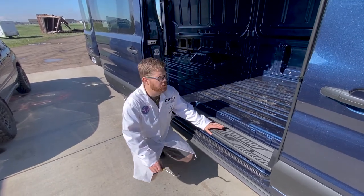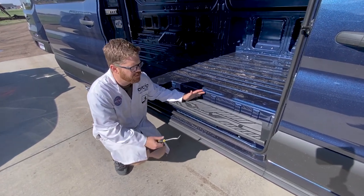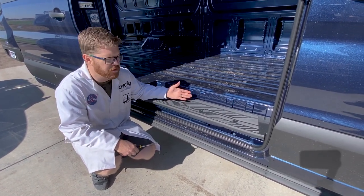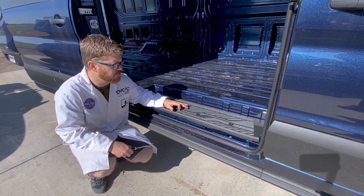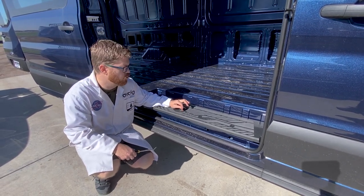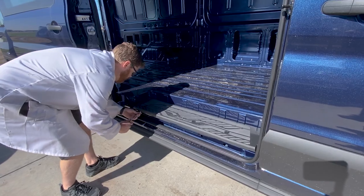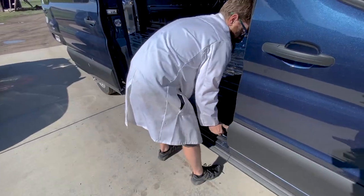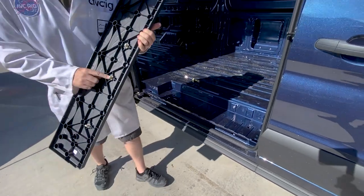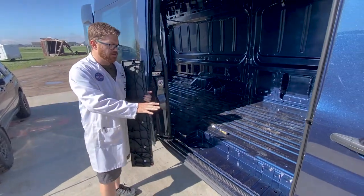If you're using our floor kit, we provide our AVC step. Our flooring system comes into about here, giving us a 33-inch opening, with a step that's a little bit superior to what Ford gives you. If you're using our step, then you don't need to be gentle with this step at all — we can just pop this thing out aggressively. If you're going to save it, pop these little plastic plugs out and pull out the Torx screws inside. For us, we just grab the step at the front and pull out, which pulls these little plastic retainers out.